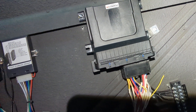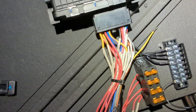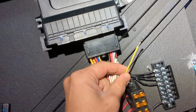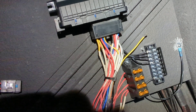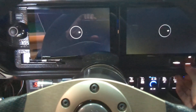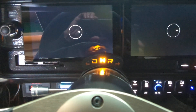One reason I like this connector is it's got a bolt system — once you get the connector in place you just use a little quarter inch wrench and cinch it right up. That's all it takes. Time to power it up. I've got the ignition on and now we'll fire up the T2C and we should see it go into neutral here — and there it is, it's ready to go.